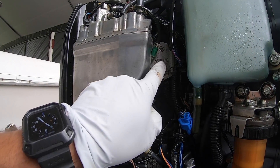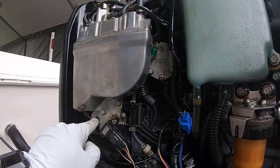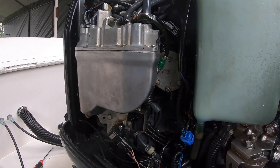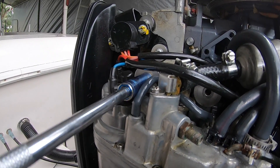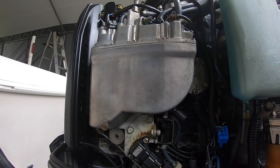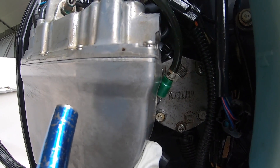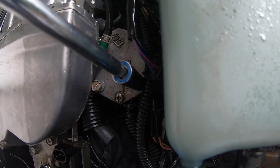To reach the top low-pressure fuel pump, the VST system is kind of in the way. Easy trick: remove the top-right bolt and loosen — but don't remove — the other one. That's going to let us move it just enough out of the way so we can access that 10 millimeter bolt. Then remove the tie wrap.